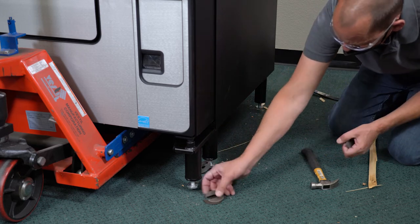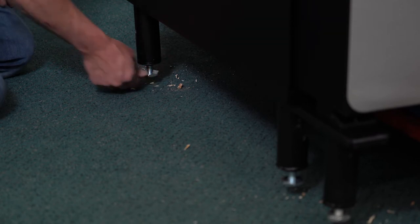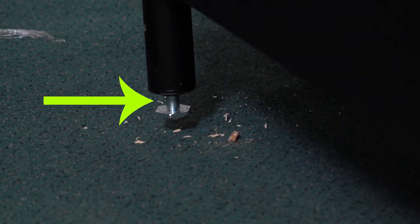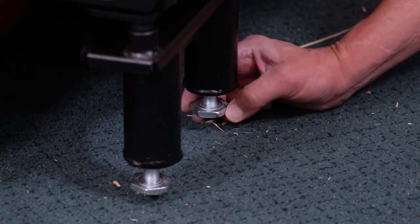You can then dispose of the wood boards and metal washers. After removing the skids and before leveling, make sure the legs have a half inch between the black part and the base of the leg. Raise the leg base by turning it counterclockwise. Do this for all six of the legs.